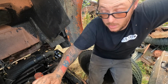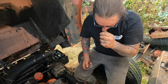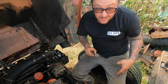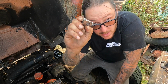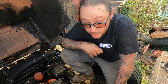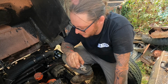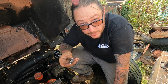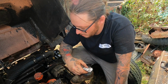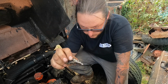All right, so I figured I'd take this second as a teaching moment for anybody that cares to listen or feels like I might have something to offer. If you don't, skip past it. But so we weren't getting any fire, and I checked first thing coil, make sure we were getting power there. We were. Next thing I checked was to see if the wire coming from the distributor was grounding or not. So I'm sure most of you, hopefully most of you, are familiar with ignition systems and how these work.